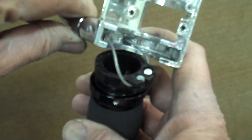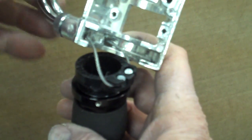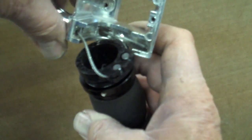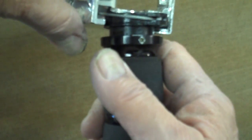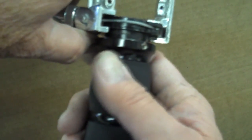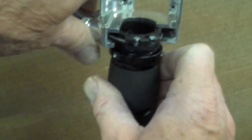I've got the adjuster all the way down so there's maximum play in the cables now — this adjuster and the one on the carburetor are both all the way down. I've hooked the cables on outside the housing. I open the throttle a little bit as I put it in there and kind of pry it in. There it goes — pop that over, make sure the cable underneath is in under the housing good. It fit this time and there's plenty of play in there. I think we're home free on that one.